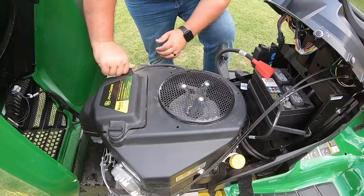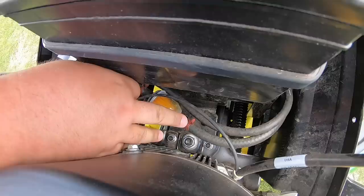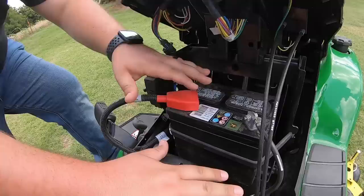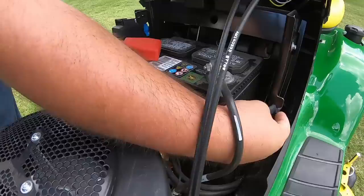Moving back behind the engine, we do have the fuel filter. We've got two red clips — just take a simple pair of pliers, release those clips, get the old fuel filter out and install the new one. Super easy back there. Also right here, we've got plenty of room for the battery. It's held in by a strap that can be easily removed by taking it out of the notch. Very open and easy to get to.